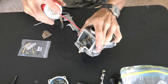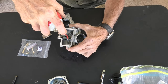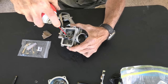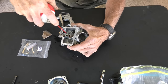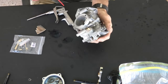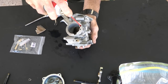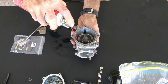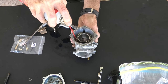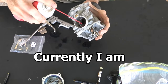Half the time I lose these nozzles, but I didn't. Now I am going to spray down into the passages where the jets sit and make sure they're cleaned out good. This is always a good idea because you can also check when you do this if everything is running through all the passages because of the liquid, instead of just trying to blow air and feel it out the other side — because they are such fine passages. I'm convinced everything is looking good here. I'm spraying some in and under the carburetor, and just giving every opening a shot of the cleaner. I'm trying to show you all the openings, both air and fuel, that I have found on this carburetor. If you follow the video you'll know where everyone is located.